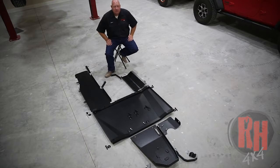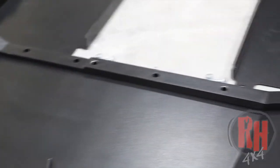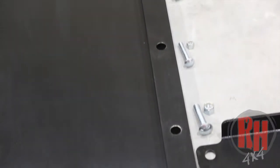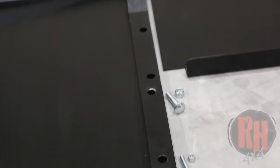When we originally built this, we designed it with that oil pan skid longer and went out and did quite a bit of testing, but we weren't able to get the strength needed to give you an adequate system. So we went back and re-engineered the skid plate system to what we've come up with now, which has these dual crossmember systems in it. We've added this one-inch by two-inch solid steel piece of crossmember — not a tube, but a solid piece of steel — machined, drilled, and tapped where needed. This has allowed us to get the bracing we need to give you the strength required.